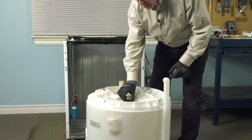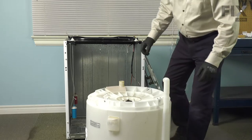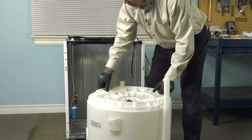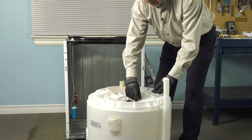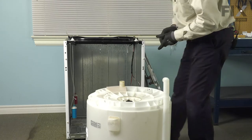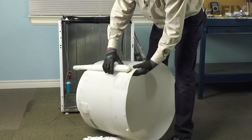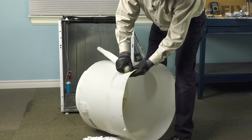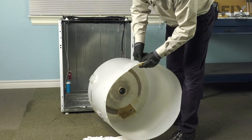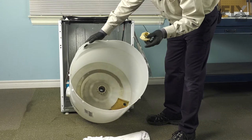Next, we'll need to make sure that we have that washer that sits on top of the outer tub bearing — we'll keep that. We'll also need to pull out the inserts for the bolts that mount the transmission and motor assembly onto the tub. Just pull all those out to be reused. Next, we'll need to remove the overflow tube from the side of the tub. Just pry it out of that grommet, set it aside, and then that grommet should just push out through into the inner portion of the tub where we can remove it to be reused on the new tub.